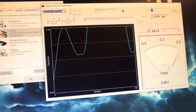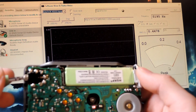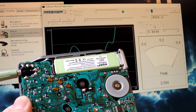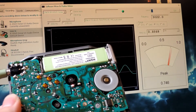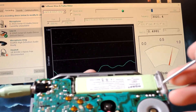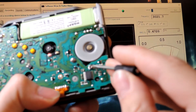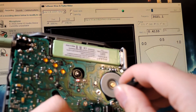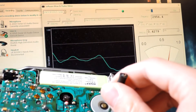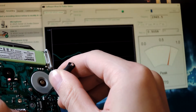That's what you're looking at — it tells you the speed on the top right. It's reading plus 22Hz. Normally for Sony and the newer Panasonic, you want to calibrate as close to 3kHz as possible, plus or minus 3Hz — that's the range you need to calibrate to. You can see the adjustment screw is next to the motor, and I'm adjusting it to the correct speed.